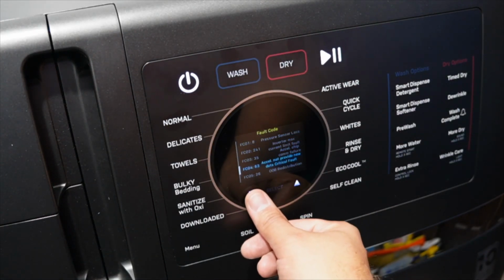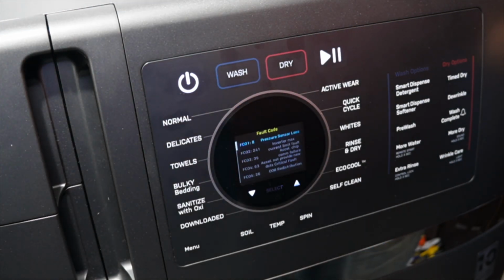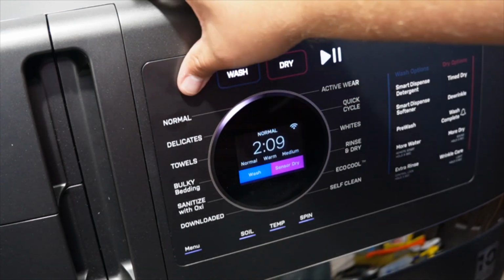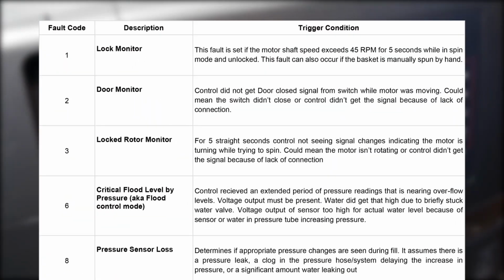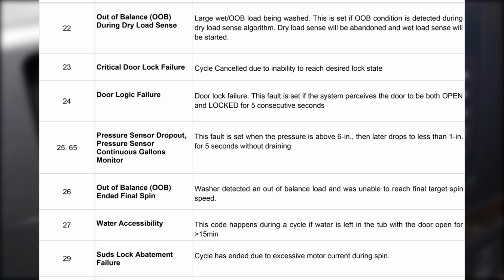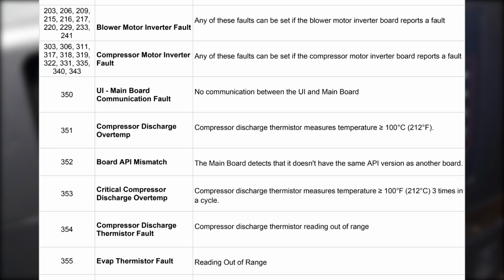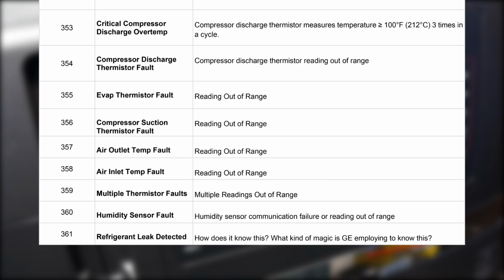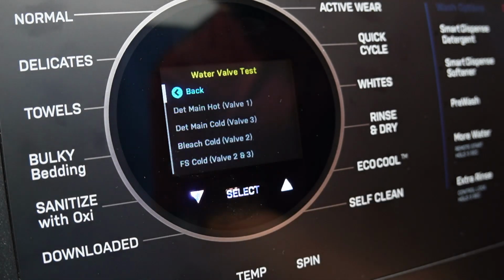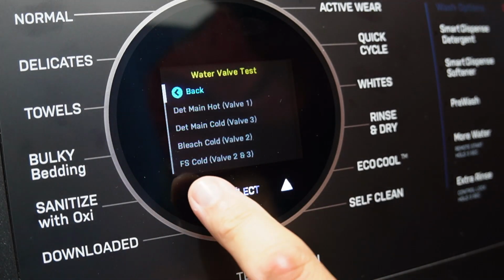I'm going to have a link on how to check the diagnostic codes in the description, and it should be at the end of the video. I would look for anything mentioning the water valves, pressure sensor system, or the control board itself, and this list could vary, and that video will have a more extensive list of what could be going wrong. That same video will show you how to test the water valves as well in a later segment. You can force them to turn on or not.